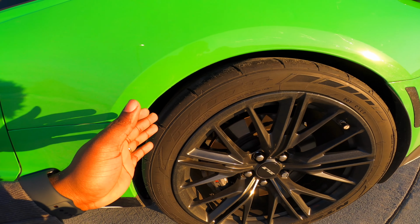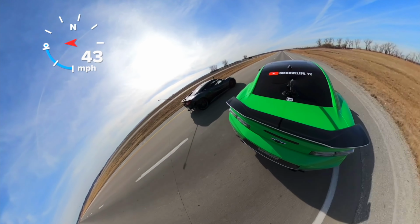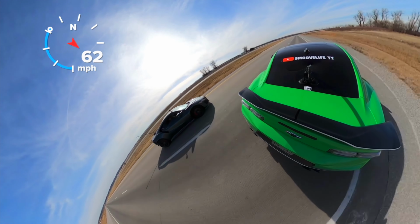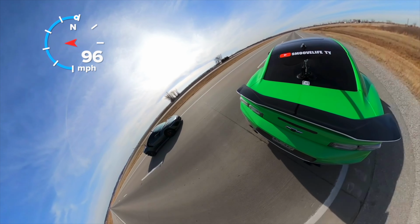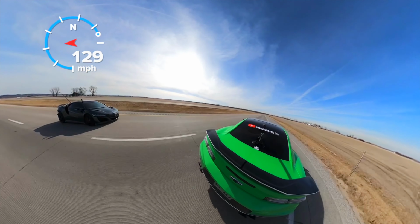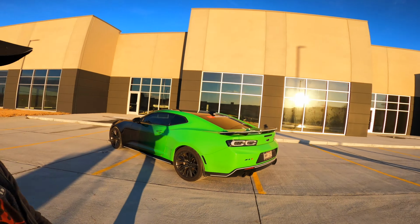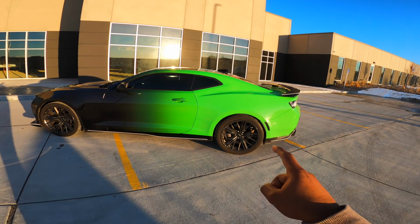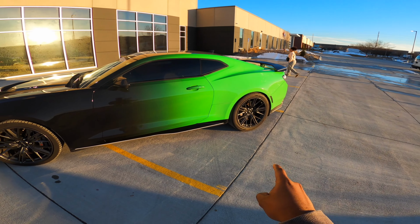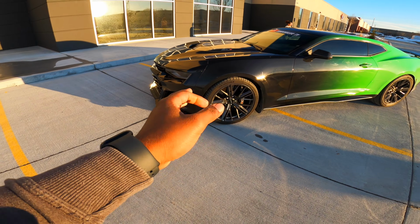I struggle hooking under 30, but at 35, 40, 40 rolls and up, we hook and book. It has to be warm outside on the prep track, but 40 rolls and up, we hook and book, you guys. Tires are essential in a car like this. Fronts have all seasons because it was below freezing, but I gotta change those to some more aggressive front tires also.